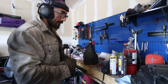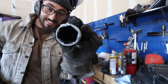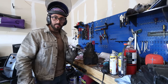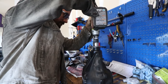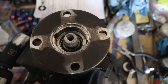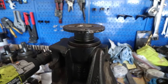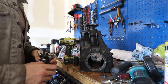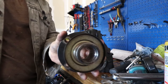Looks like we finally got something on there that works. I just had to grind it down quite a bit - you can see it's a little bit thinner now, but it's going to work. I got this on Amazon, cheap part, I knew I was going to mess it up. So anyway, let's get the impact and get this sucker off. There's the top half. What we're going to do is tap that out to basically make it fall out in here, and we should be able to get that pinion out.